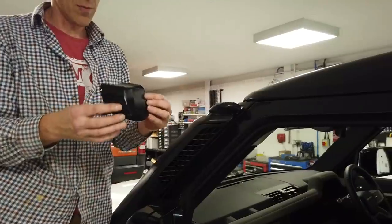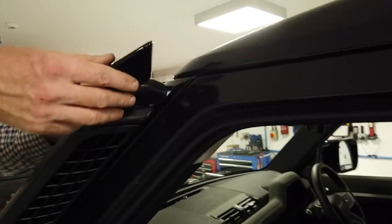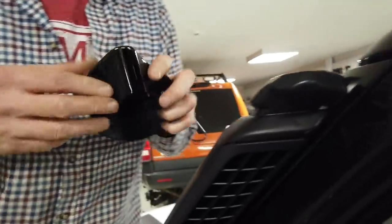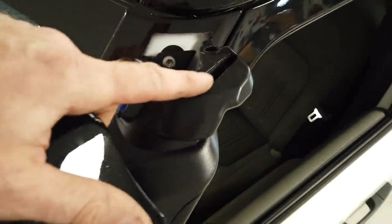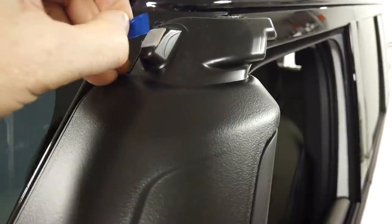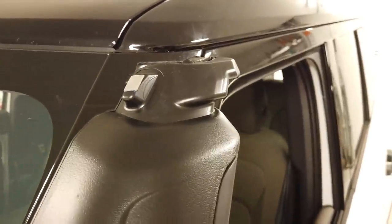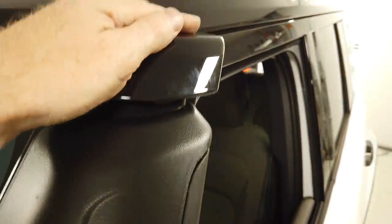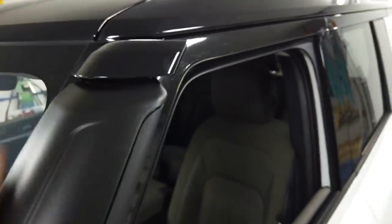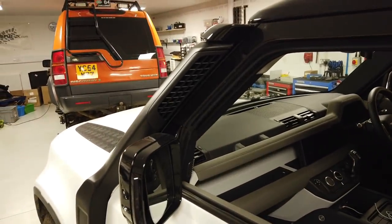Put the gloss black cap on now — this concave surface goes against the A-pillar. It fits with a little spring clip, so line it up and it goes into that little groove. One thing before you put the cap on: there's a little bit of double-sided tape — remove that backing before you put the cap on. There we go — that should keep it all secure. That's the raised air intake all finished.